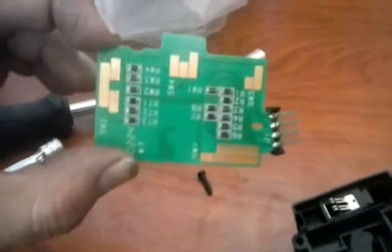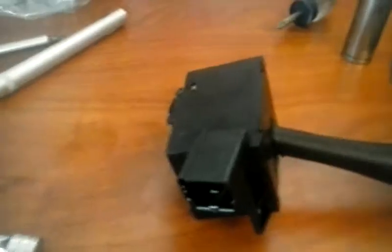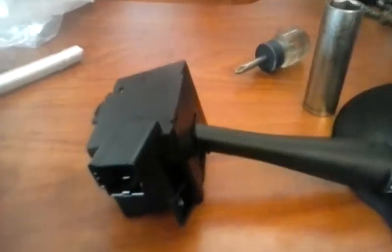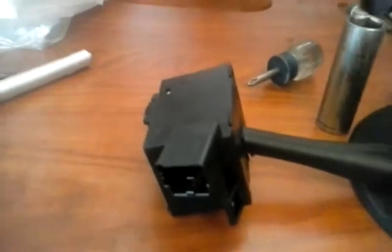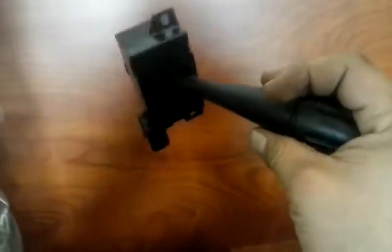I've removed the motherboard simply by lifting it off and pulling it out. I've got that cleaned up, contact points cleaned up, and some new grease on there. After pulling the circuit board, cleaning it all up, reinstalling and checking — I'm still not getting any signal, any power to the motor, although the motor checks out good. The motor is not bad and the fuse is good, so I'm going to call it: yes, it's time for a new multifunction switch.